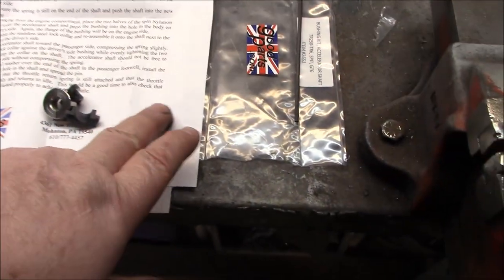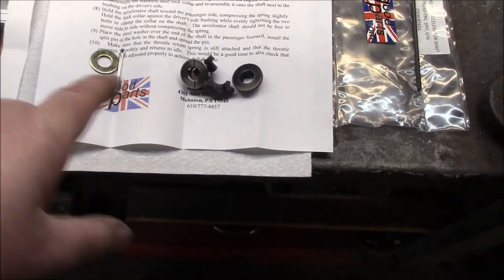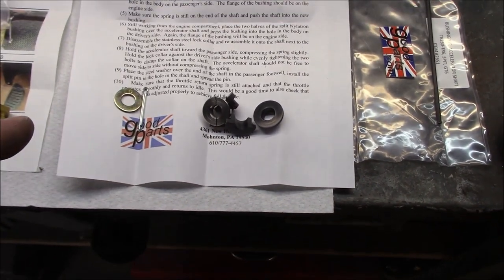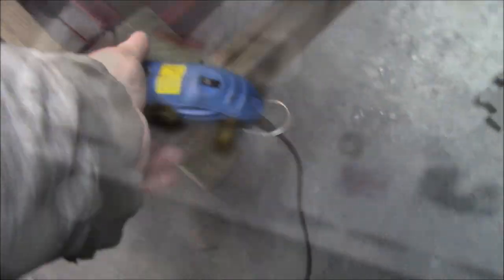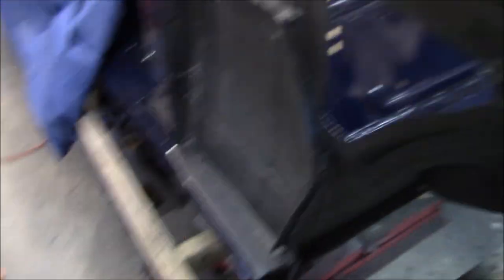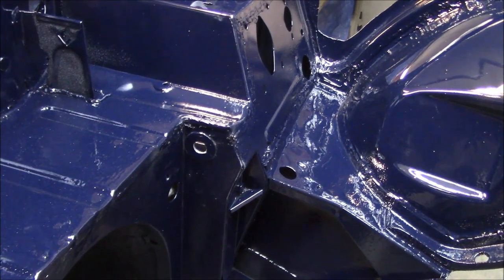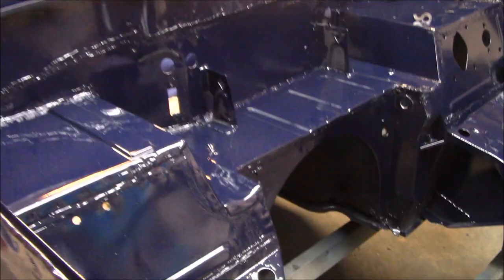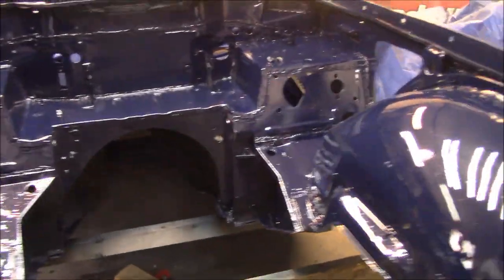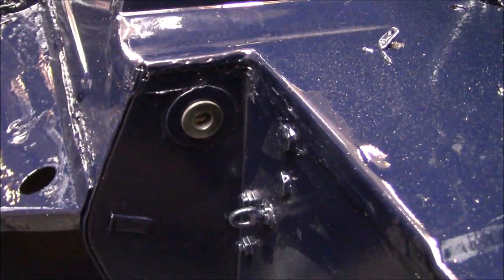So let's go to the install — we're going to use the Good Parts kit; I like the style a little bit better. We'll keep the British Parts Northwest kit as a backup for a future project. First thing I did was clean out the bearing surfaces — epoxy and paint and clear had built up in there making it pretty tight, so we've cleaned those up. We've gone ahead and put the first bushing in — the uncut bushing on the passenger side.